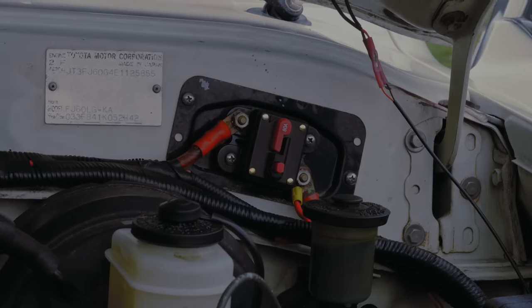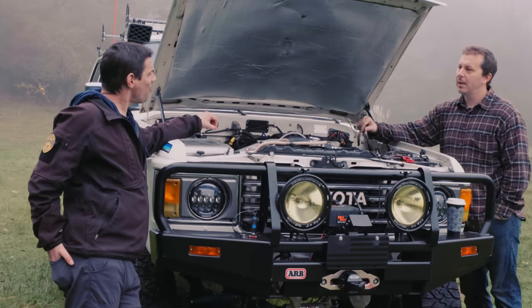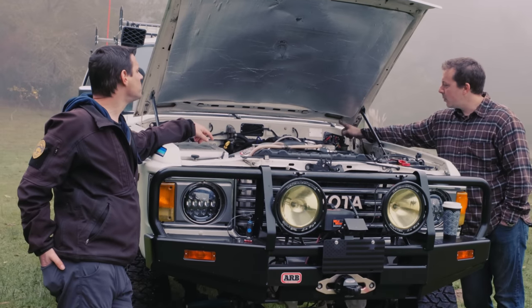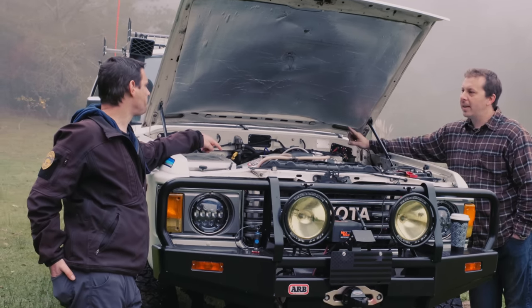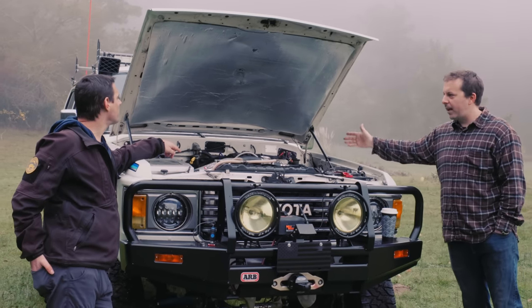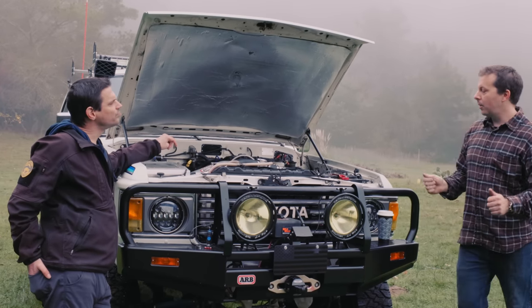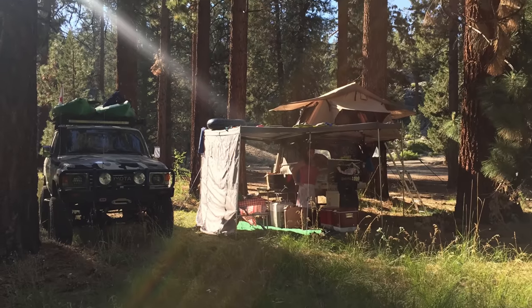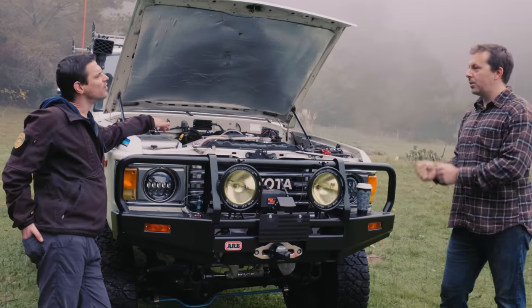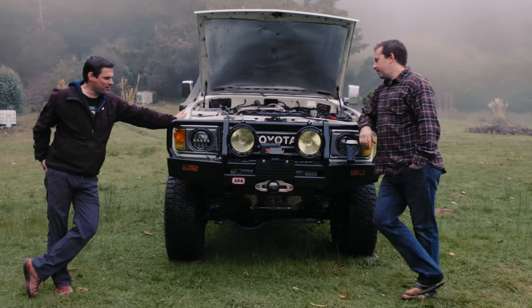There are two breakers. One is a 100-amp dedicated to all the air stuff — so if there's any issue it's isolated. The other is where the Chevy meets Toyota. Everything from the firewall back is unmodified Toyota harness, everything firewall forward is unmodified Chevy harness. The goal is we're never getting rid of this vehicle — I'll totally forget what I did — so I can open a Chevy manual and a Toyota manual and fix anything exactly as it ought to be.